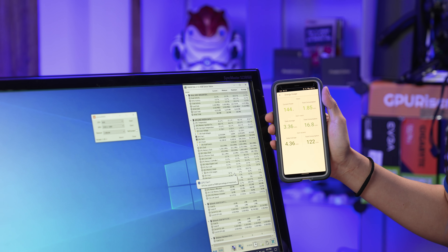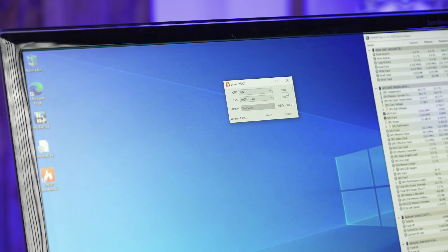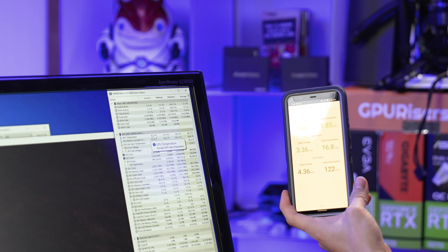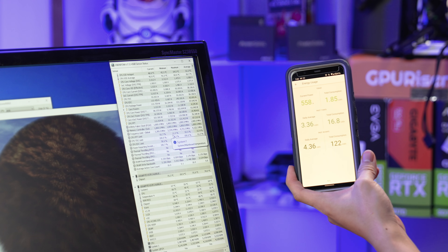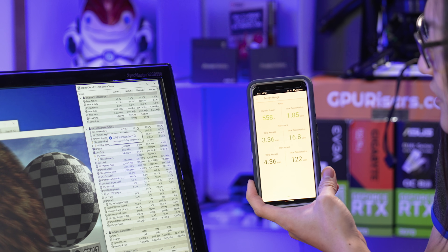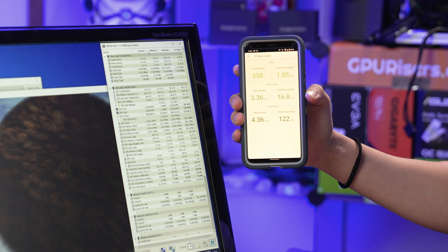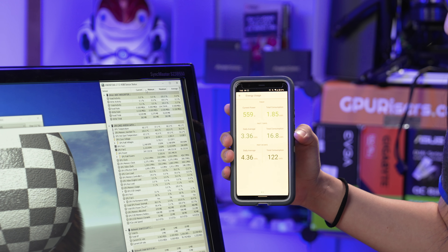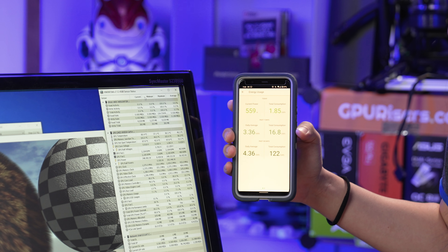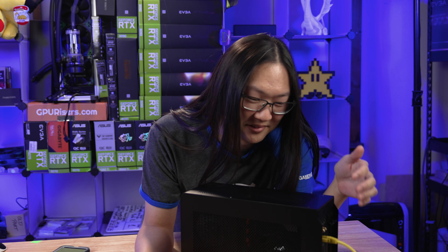So let's see what happens when we do both the CPU torture test and the GPU torture test at the same time, and let's be mean to it running for five minutes. So we're going to start the CPU and the GPU at the same time. GPU is currently at 75 degrees and climbing. The CPU is at a nice 66 degrees and climbing, and we're still pulling 560 watts constantly. The GPU is starting to climb up there — we're at 78 degrees on the GPU, 79. Memory junction temperatures at 110, 102. So choking off that card is starting to show. We're at 80 degrees on the GPU. You can probably hear on my microphone the GPU starting to ramp up. I can actually feel this, it's pretty hot — it feels like a little heater. All this heat is waving up on my face here, and you can actually hear the fan of the GPU starting to ramp up. It's actually getting kind of loud, getting real loud.